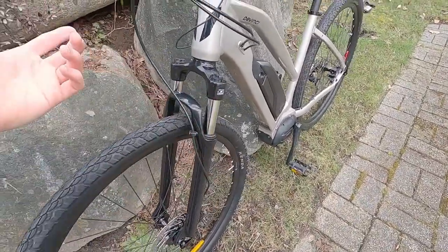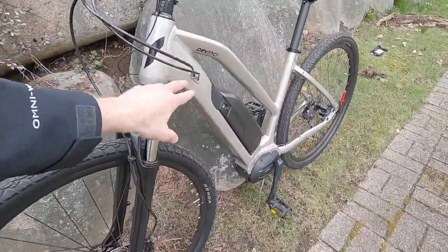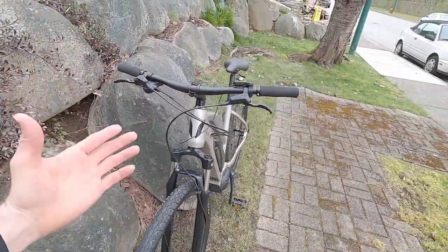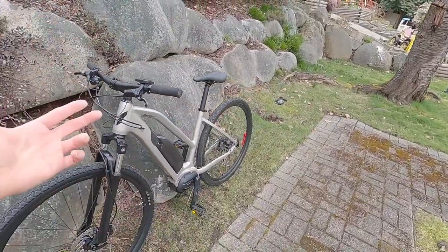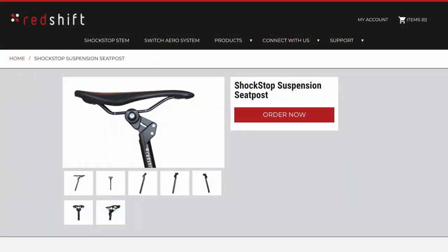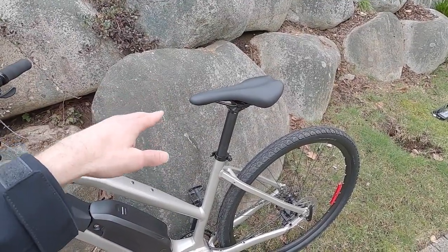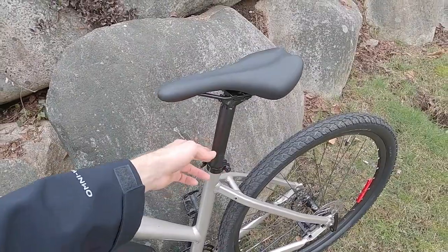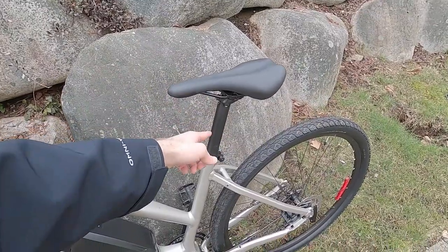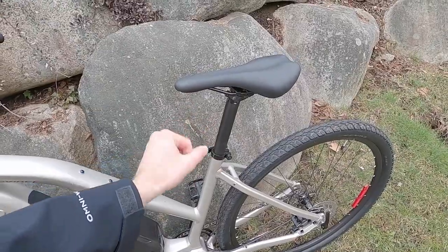63 millimeters of travel, these are 28 millimeter stanchions, steel, kind of standard. The black looks really nice. It's not frame-matched, but with the black accents and their logo, I think it still does look nice. If you're someone who rides pretty regularly and maybe you have some back and neck sensitivity, I'm always calling out suspension seat posts as a nice option. Seems like people ride for longer distances and maybe at relatively higher speeds when they're on electric bikes. This is 30.9 millimeters — you could swap that out with like an SR Suntour or maybe a Cane Creek Bodyfloat. Lots of options these days.